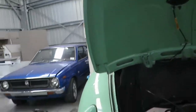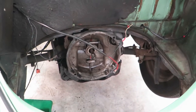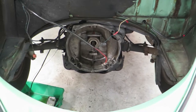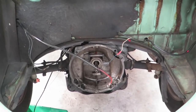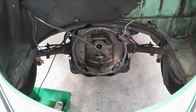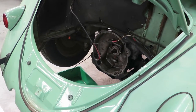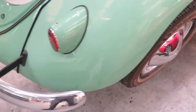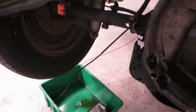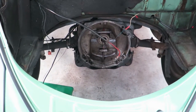Welcome back to Dustin's Garage. We're going to pull the gearbox out of the Beetle and see where the noises are coming from and fix the oil leak out of the side. We bought it with a noisy gearbox and the lady said she'd been told it's okay to drive but it is noisy. It should have a straight-cut first gear so it may be noisy, but it kind of sounds like it's missing teeth. I've drained it already and there were no big chunks, but it was also very clean so it's probably been replaced before - there's red silicone around the two halves so someone's had it apart. We'll whip the rear wheels off, the brakes off, drop the rear shocks, pull the back seat out, remove the gear linkage coupler and we should be good to go.